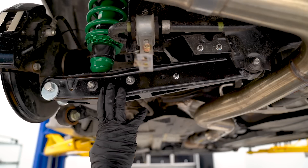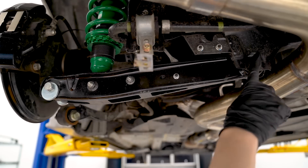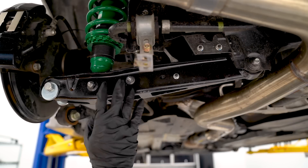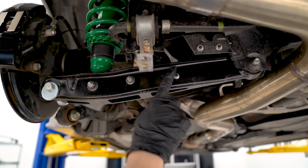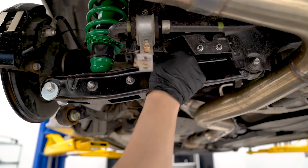In the rear, we've got three bolts to remove: the lower strut mount, the link, and the control arm to the subframe. Also, if you happen to have a model that has auto-leveling headlights, you will have a linkage on the driver's side — remember to take this off, otherwise when we go to pull this control arm down, you're going to damage the linkage.